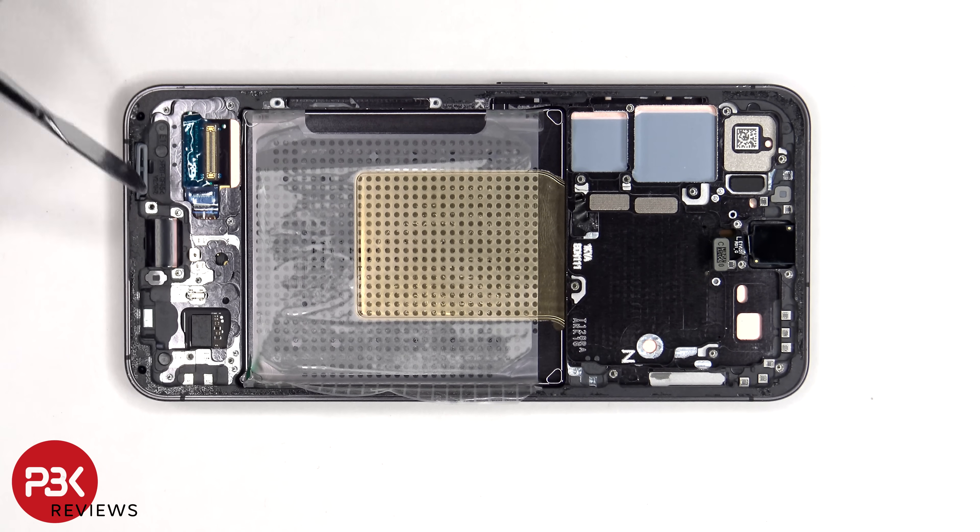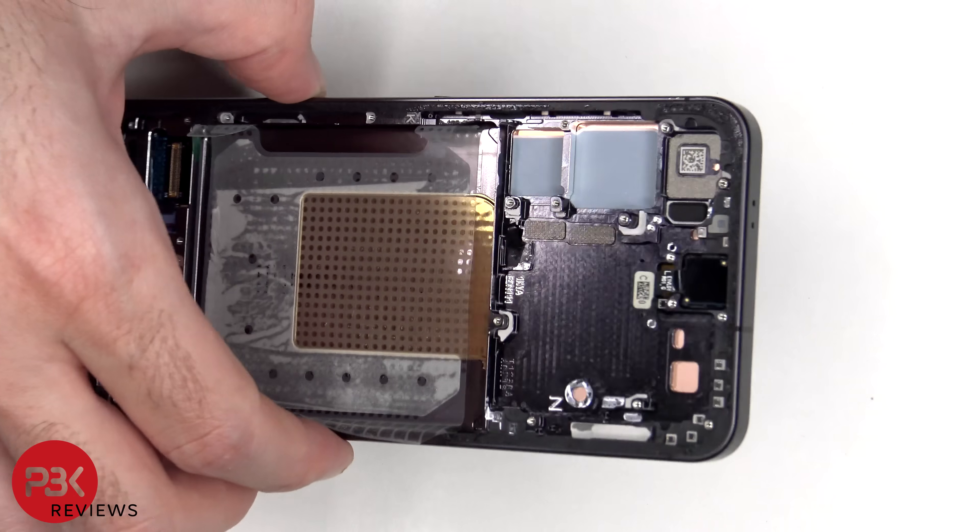There's a rubber gasket and mesh filter with a speaker opening on the frame, as well as the microphone openings on the bottom and top. If anyone's worried about damaging the microphone or the filter by accidentally inserting the SIM ejector tool in the wrong hole, you don't need to worry since both the filter and the microphone are seated above the hole, so they won't get damaged. The second hole on the top of the frame is just an air vent hole.